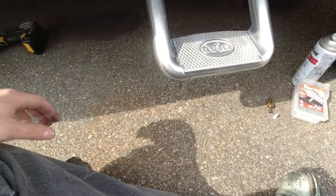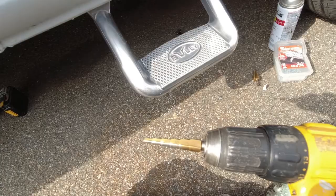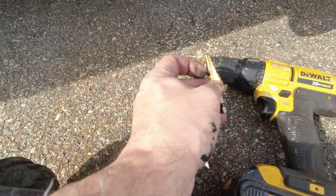That step is on and nice and solid — I'm very happy with that. A couple of things as I went along: I had been using this step drill to get out to the 7/16ths I needed because I didn't have a 7/16ths drill bit handy. The problem is for the lower hole I was bumping up against the inside of the rocker because of its depth. So I swapped to a shorter step bit that hit 7/16ths much sooner, and for simplicity I put a little bit of Sharpie on it so I knew when that black area was up against the van I'd gone down to the step I needed.